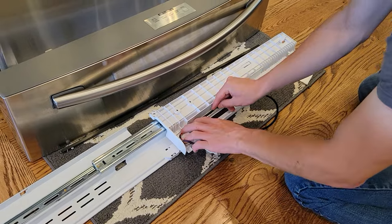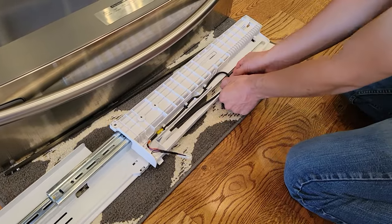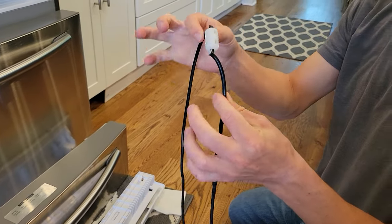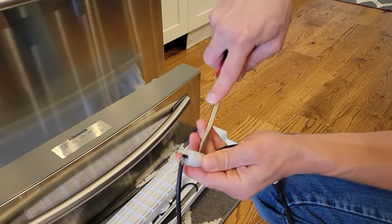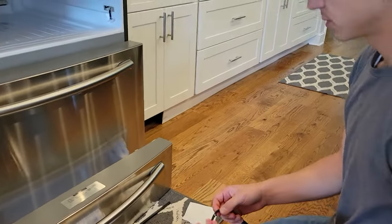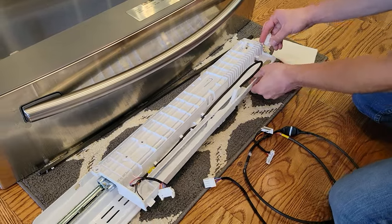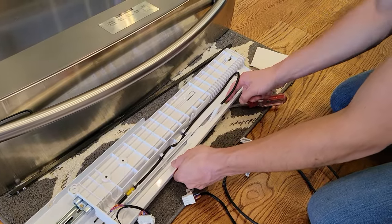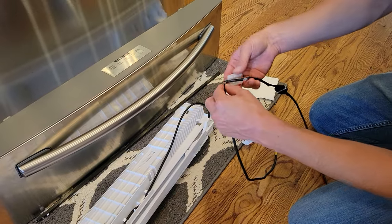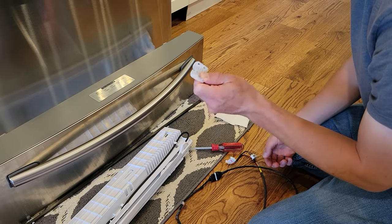The rest of it just kind of feeds along through these clips all the way down the rail. We're going to take the bead from the old harness near where it broke — we're going to take this piece off to help it guide correctly and then take some steps to make sure it doesn't break again. This little bead piece is supposed to go here on the end to keep the cable from going through this slot in the track and getting pinched. But we're wondering if it caused it to stay too straight and bend over time, so we're going to try leaving this off.